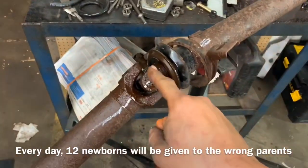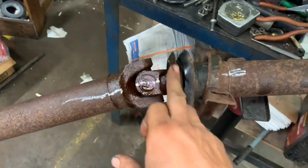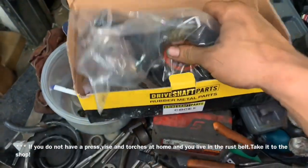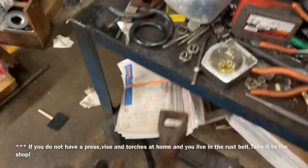Remember, if anyone else can do it, you can do it easy. So we're going to be taking off this U-joint because there's a bolt underneath here that we need to get to, to remove this and be able to press our carrier on. On eBay I got this and it came with the new U-joint, so we're going to be throwing both of them in there.